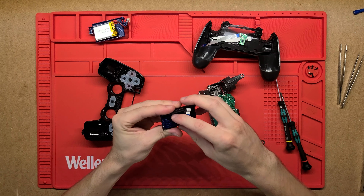This back plate — the plastic bit — holds it all together and provides support. There is also a button: if this whole thing is pressed, it acts as a button, so there'll be a button on the PCB somewhere. This is the front side of the controller with all the buttons; there are rubber membranes with black contacts that just press onto parts on the PCB to activate those buttons.